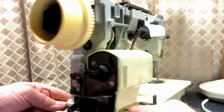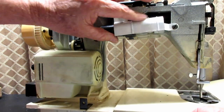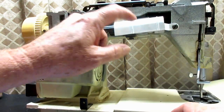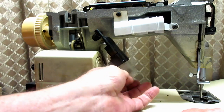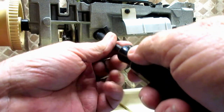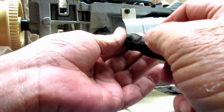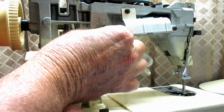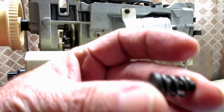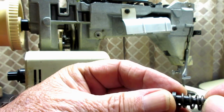I'm going to go past the motor and over to the light. This white part you see up here is a heat shield, and if you want to remove it you take out these two screws that go through it. To remove the light and wiring, it's on a kind of hinge screw with a spring around it. You just take that out — don't lose that spring. Once you start loosening it there's no tension on it; it's just the hinge screw with a spring.